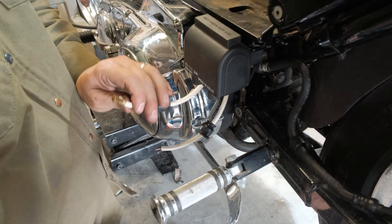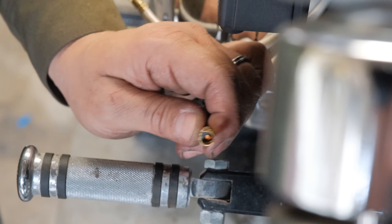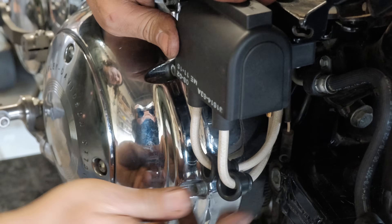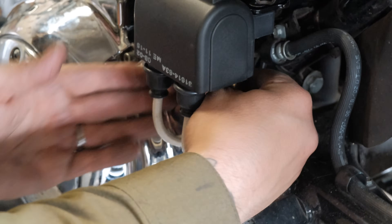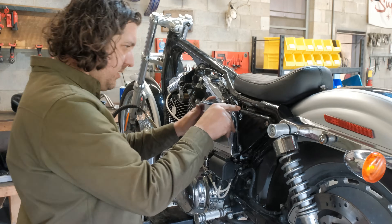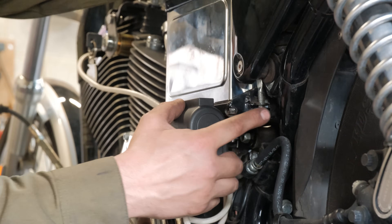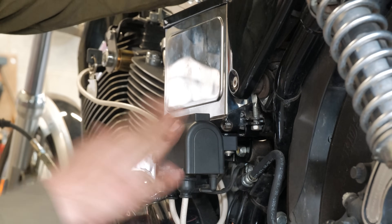Do the same to the other side. Now that you have both ends crimped, insert them into your coil and slide the boot over. Take your leads that you ran and connect them onto the back side. Lastly, put the battery back in and tighten down both bolts — that battery strap is actually what holds the coil relocation bracket on this side. Tighten them down and we're relocated.